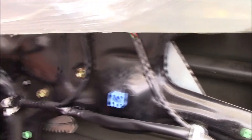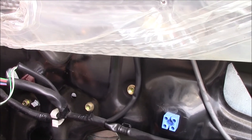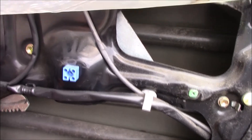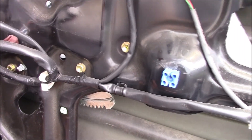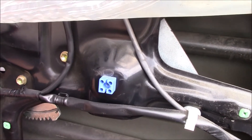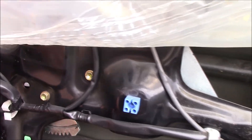Here's the regulator. We're going to have to lower the window so you can get to the mounting points. There are two bolts on this side and another one over here — looks like about 10 millimeter. We're going to try to lower the window, get the glass off the track first, and then work on replacing the regulator.